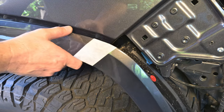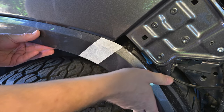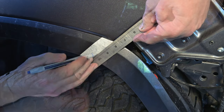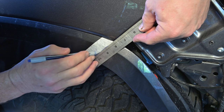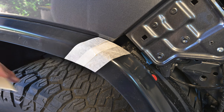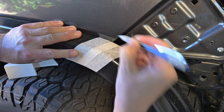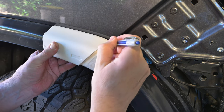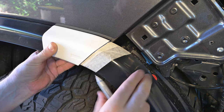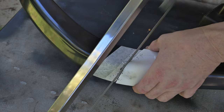It's now time to cut and prepare the guard trims or flares for the new bar. If you have factory trims, put some masking tape on the trim where the guard ends, then loosely reclip the trim into place and use a straight edge to mark the trim continuing the guard line. You can then remove the trim and cut carefully along the line using a hacksaw. If you have the OTA flares, put some masking tape over the flare at the end of the guard, clip the flare into place temporarily then put a small mark next to the fold in the guard. Put the cutting template over the flare and mark a line all the way around.